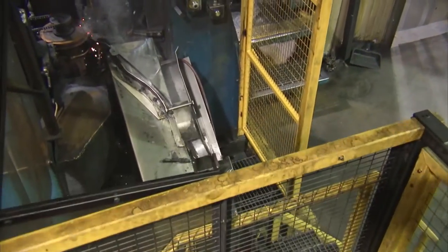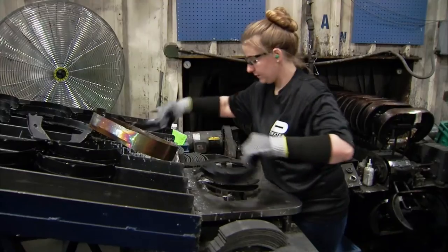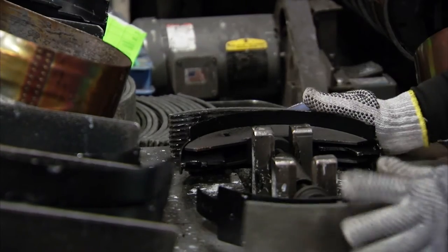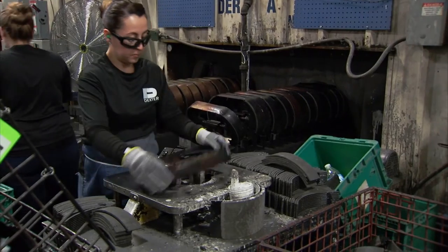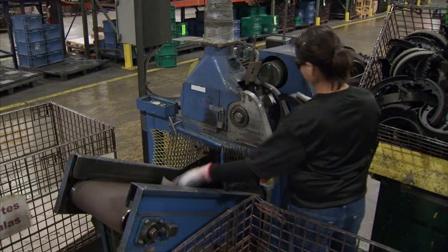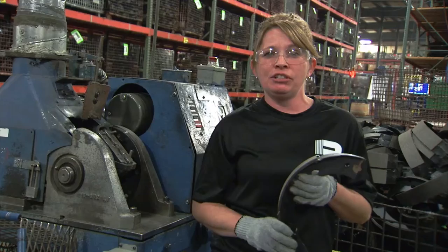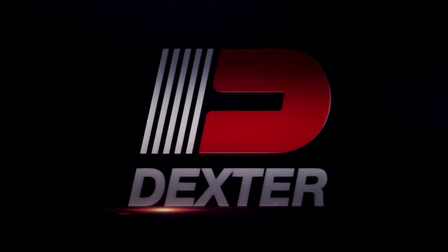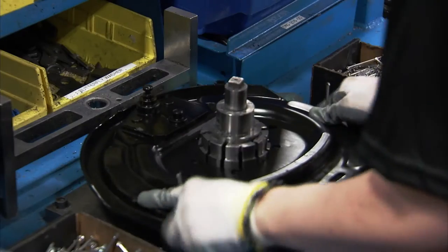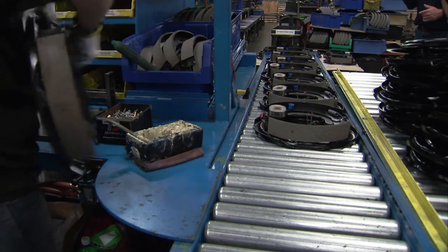Each brake shoe rim and table are welded and ground before being cleaned and specially coated. Afterwards, they are inserted into the shoe binder with the appropriate brake shoe lining. The baking process carefully adheres the brake lining and the shoe assembly. High precision grinding of each brake shoe assembly ensures braking performance is at its best from day one. Skilled operators are entrusted with the final assembly. Ongoing visual and physical inspections occur to ensure quality at the final stage.